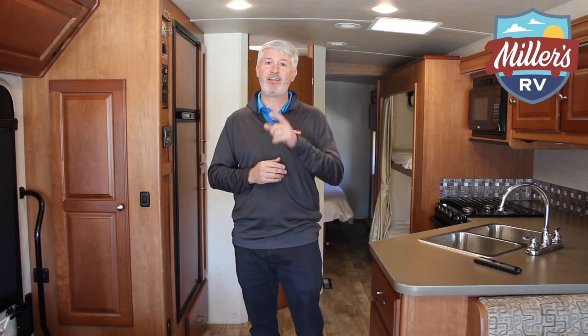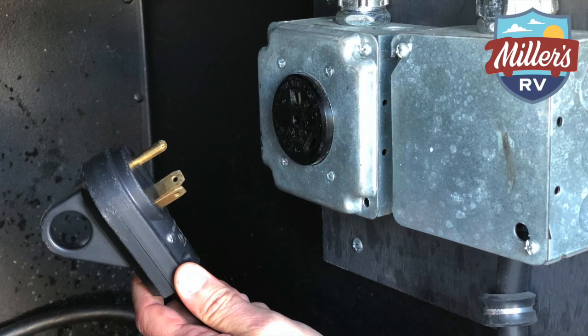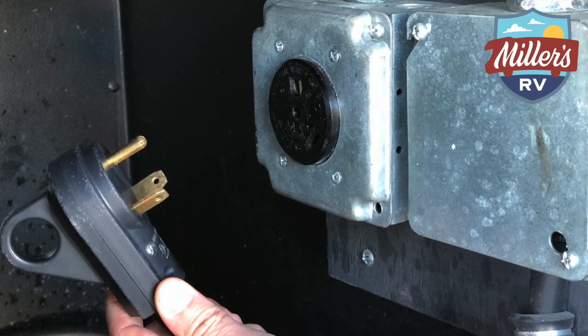If you're on your generator — the most common call we get — my generator is running but I don't have power. Motorhomes fall into two categories: ones with an automatic transfer switch, and ones without. If there is an actual outlet in the compartment where your power cord comes out — three prongs for 30 amp or four to five prongs for 50 amp — you've got to plug your cord coming out of the RV into that outlet. You've got to plug the motorhome into itself. If you don't do that, you're not going to get 110 power. That's the most common issue when the generator is running but there's no 110 power in the coach.